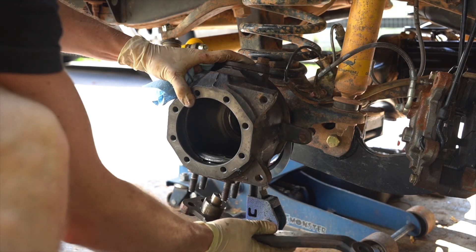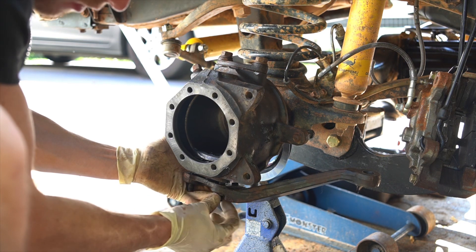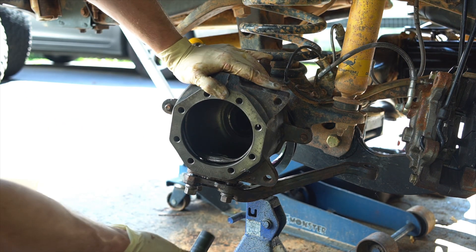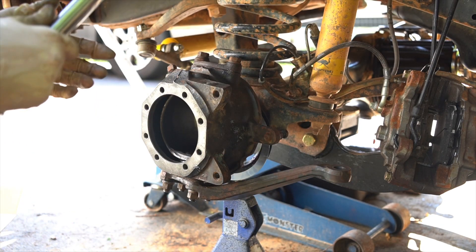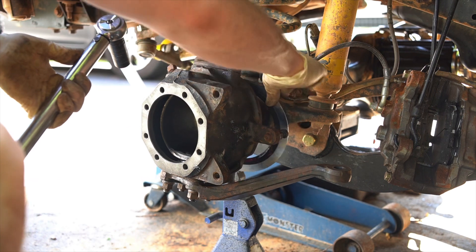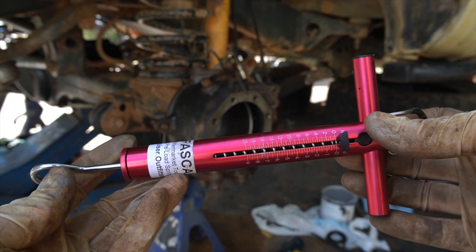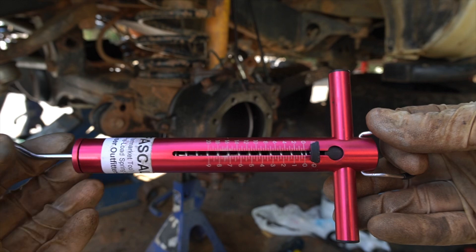With a small hand ratchet, evenly start tightening the cap down — a few turns on one side, a few on the other, repeat until it's sitting all the way flush with your knuckle, then snug those down. Now we can start installing our steering arm, which fits inside the lower bearing just like our cap fit inside the top one. Once you get that started, remember the cone washer setup: cone washer, flat washer, then a nut — do that until snug, then place the rest of the cone washers, flat washers and nuts and tighten in a star pattern until it's completely flush with our knuckle. With all bolts run up, torque them down — be cautious that your steering stops are going to want to go all the way back, so make sure you're not going to smash your seals. Torque these down to 71 foot-pounds. Next we're going to use a spring gauge from Cruiser Outfitters to check preload — hook it onto the steering arm and pull to get your measurement in pounds.